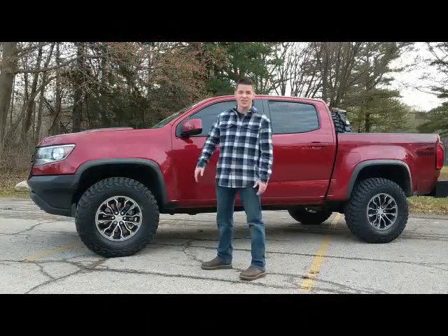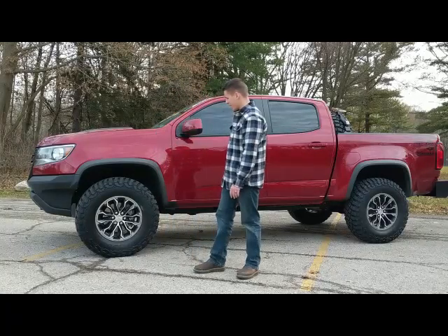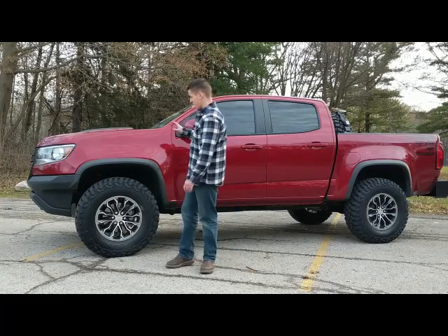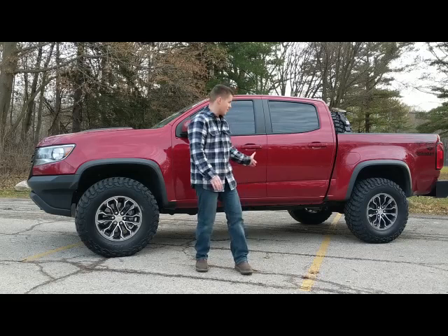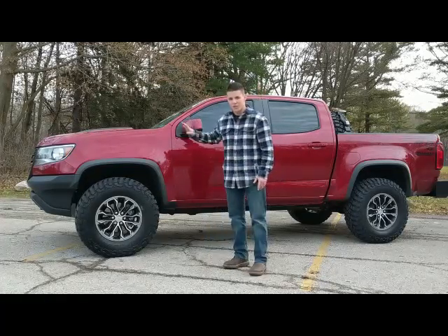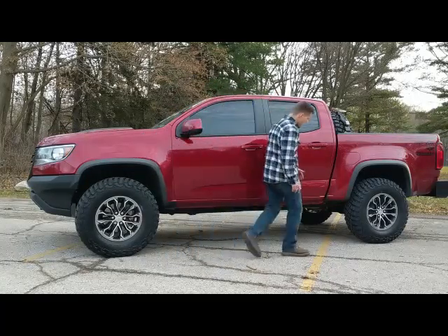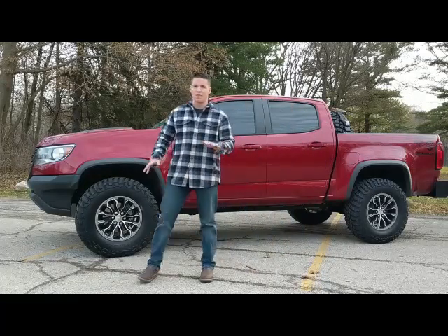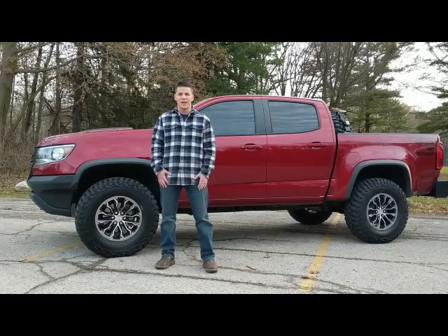Alright, back from the tire shop. Got them all mounted and balanced. Balancing, by the way — these things took a lot of weights. Two of them were off by four or five ounces on the outer, so it definitely took a lot of weights. Full clearance all the way around for daily driving. Full clearance in the front with flex. I don't have the leveling kit yet — I ordered a leveling kit for the front and an add-a-leaf for the rear, so I have about a one-inch lift coming, but it's not on the truck. This is bone stock suspension. Full clearance in the rear — tucked all the way up into the wheel well, doesn't hit anything. Full lock, full turn. In the rear, daily driving, it doesn't even get close to rubbing. But if you flex it off-road, it will rub on the front of the wheel well — so there's some trimming that needs to be addressed in the rear for off-roading.